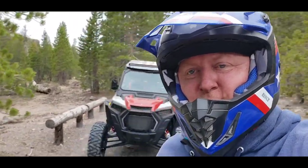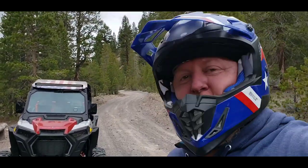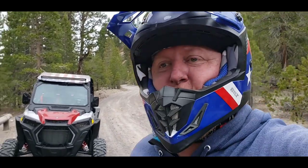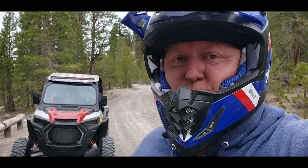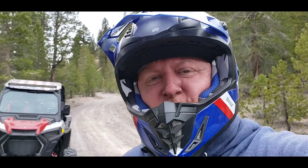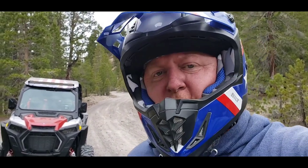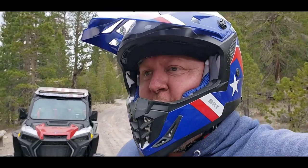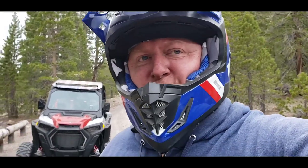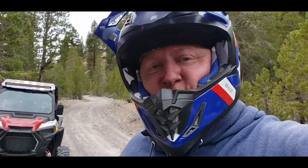That's basically what I've done to this 2021 turbo so far. I really enjoy it — that thing hauls ass, can't be happier. One last thing I can't show you: it's the RPM PowerSports blow-off valve. It's nice, but I think I'm getting some whistling and some leak on that mechanism. It's not the tube — it's definitely the blow-off valve. I'm probably going to send it back to them, hopefully they can send me back one that passes the inspection where you put your thumb on the vacuum hole. If not, I'll cut my losses and buy another one.